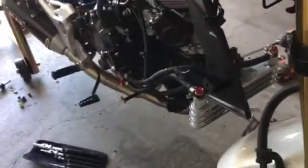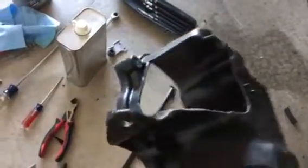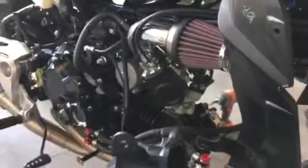What I did is re-utilize the factory air box just for support. I kept cutting it until I was able to get the bottom portion of the Chimera filter to fit in there without rubbing. Now I'm able to sit it in there, use the factory mounting points, and still use the Chimera cold air intake.